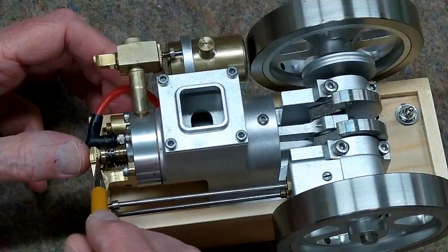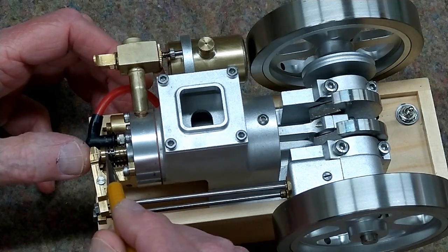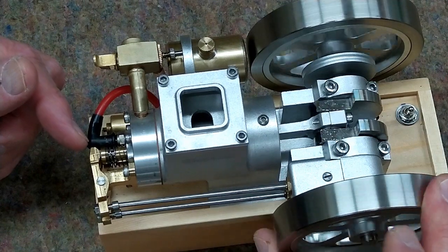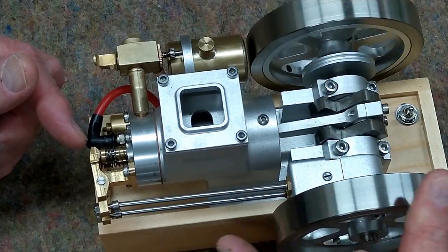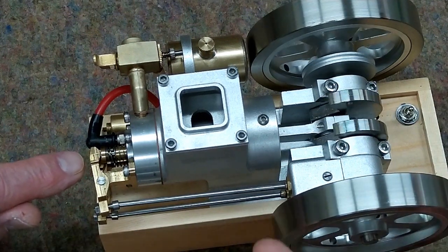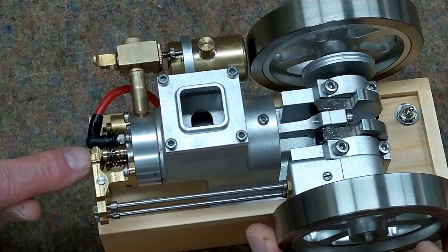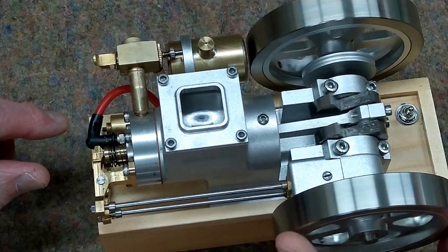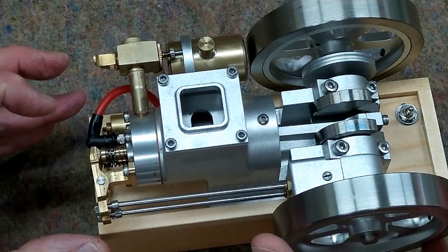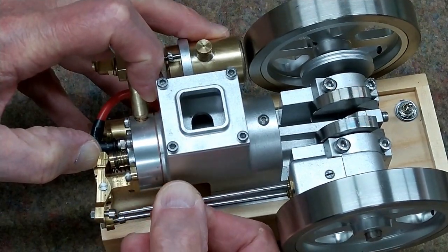For those of you who must take this apart, notice that there is zero clearance between the tappet on this rocker and this valve. On the intake stroke, then compression, the engine fires, come all the way back. Now the exhaust valve is just starting to open — we're on the exhaust stroke. Just before the exhaust closes, the intake is starting to open. Your adjustment here will have to be just right. The springs are holding the pushrods in — that's all that's keeping those in there.